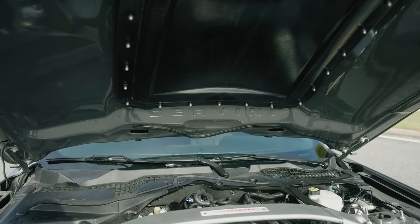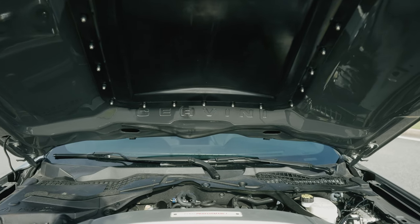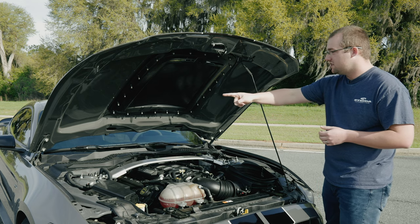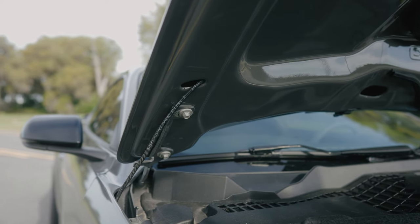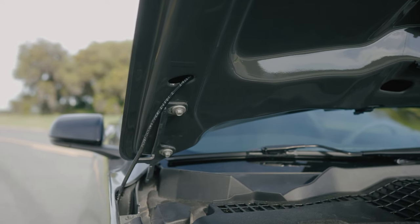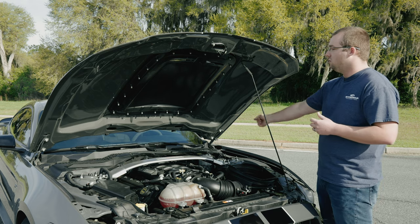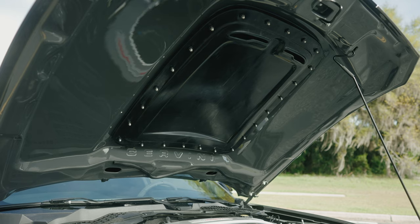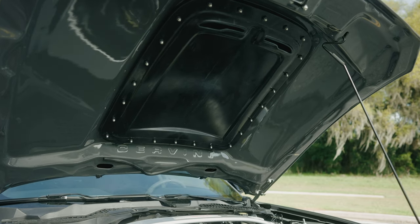It really is a genius design that looks a lot like the actual GT500, and installation really wasn't too bad. The cool part about Cervini's is that you're actually able to fish the windshield wiper line through the hood — you don't need to drill any holes to pin it into place like you do on the factory hood. The washer nozzles and everything lined up, factory washers work great, and the only holes I had to drill were for the weather stripping, which were all dimpled so I knew exactly where to drill. I put some duct tape around the drill bit so I didn't go too deep, and honestly I had the whole thing installed in probably less than an hour.